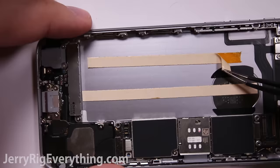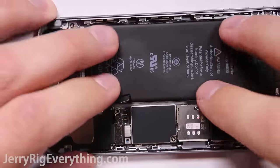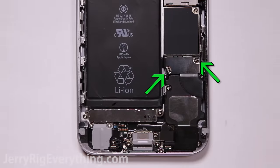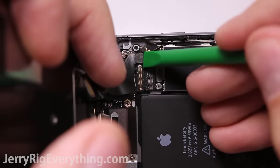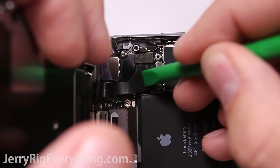To put the battery back into place, you can buy new pull tabs or just use double-sided tape and stick it down underneath the battery so it doesn't jiggle around inside the housing. Take the battery and plug it back into place. Take the two screws and screw them into the metal plate over the connection. Then take the screen and plug in the connectors — you have one for the front-facing camera, one for the LCD, and one for the digitizer. Once they're all plugged in, they're like little Legos — you can just snap them in.